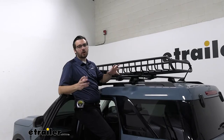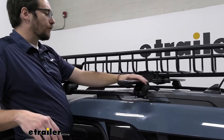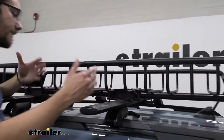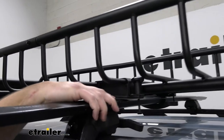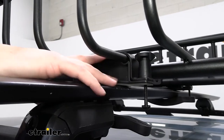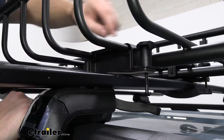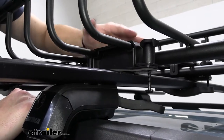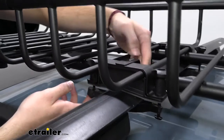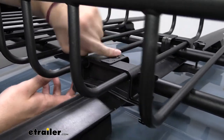To begin your installation, go ahead and throw up your Skinny Warrior just like you're seeing. What I like to do is get our crossbar lengths set — you can either shift your crossbars or just shift your basket as you want. Then simply place your plastic piece on these two knobs here, which is going to click in and stay nice and secure. That's going to allow us to put on our top bracket as well, and you want to get that around the bar on the back side.